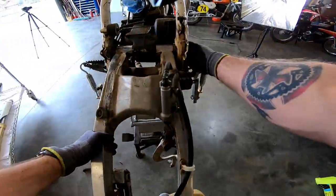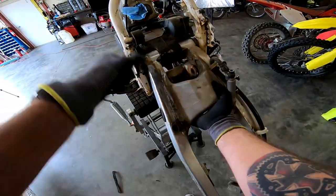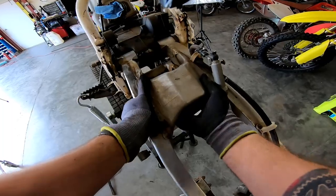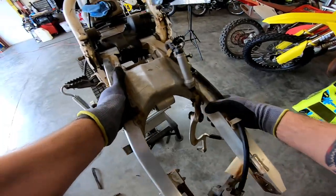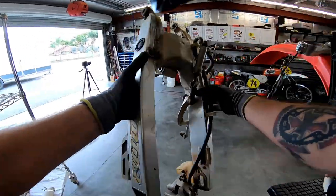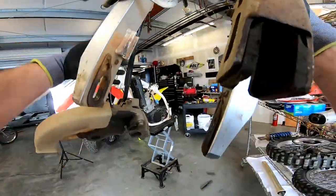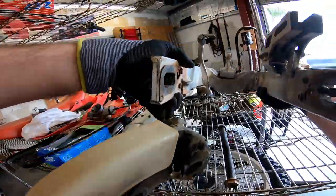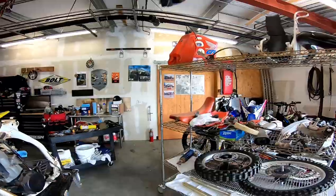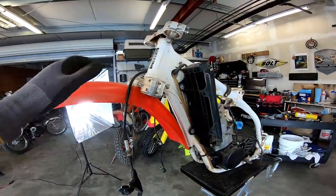This thing may be really hot, so if you've used the heat trick just be aware of that — you could get burned. We will set this aside. Swing arm is ready to be removed. Pin out. There it is — in great condition I might add. On the rack with the brakes, one piece.